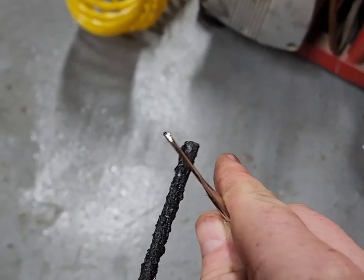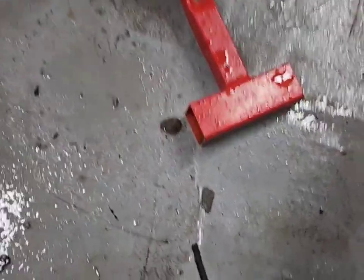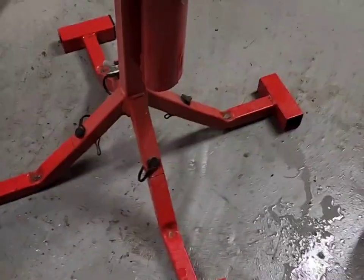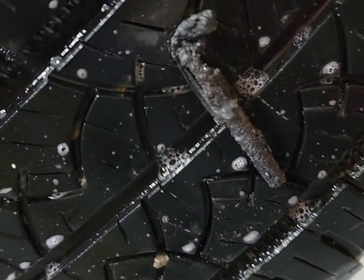Here's the reamer — it requires a little bit of muscle. Then you thread the plug through the needle. As you can see, I'm doing this one-handed, so with two hands you should be able to do that easily. What this plug does is it adheres to itself, so that way when you pull it through it slices but then it sticks together under the pressure of the tire.